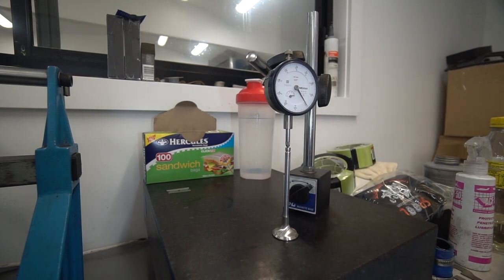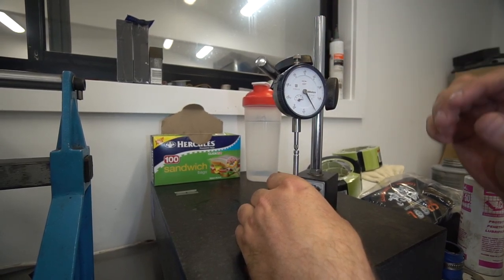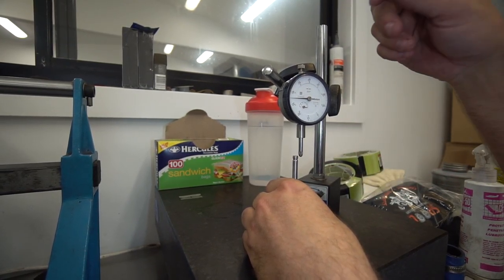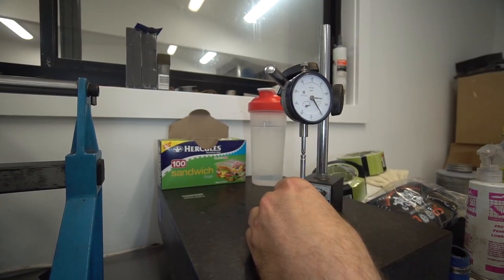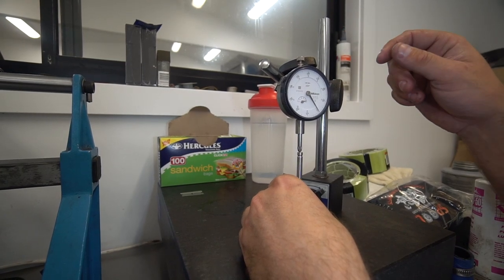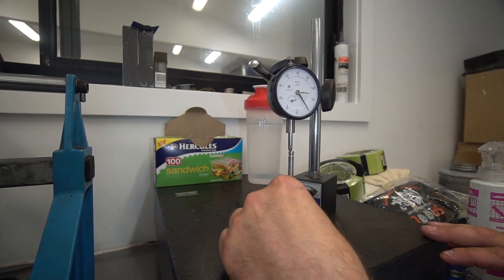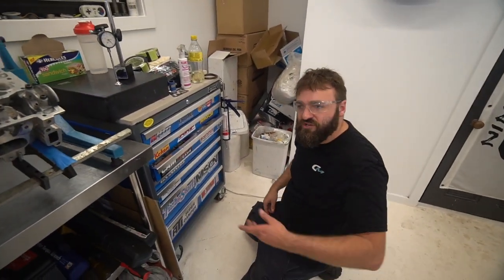Now what I need to do is take material off that until I see a drop in 3 thou. To make this repeatable, I'll make it exactly 0 because it's just off. So that's 0, you can see that. I'll lift the gauge up, come down. Now it doesn't go back to 0 because it's not on the valve, so we're actually using the dial gauge. You've got to give it a little bit of pressure. So I'll lift this up, put the valve under it, come back. Where does it go back to? Right on 0. Basically, it's just under, but that could be me touching this, you know what I mean? So you test that it's repeatable: take the valve off, move the valve around, come back. Where is it? Just under 0, same as before. So now we know what our 0 point is. If I take 3 thou off that, 3 thou comes off, which gives us our extra clearance.